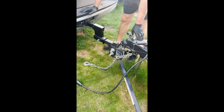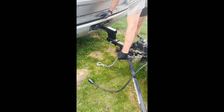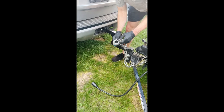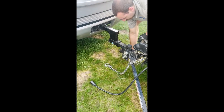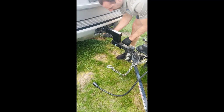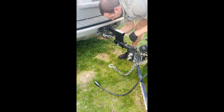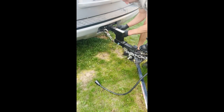We're going to hook the trailer up to the hitch now. We've got our sway bars, we've got our emergency chain, and we've got our emergency brake, which will always stay hooked into this chain until they can stay together. We're going to criss-cross the chains, so in the event that the trailer came off, this could potentially hold it on.